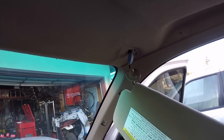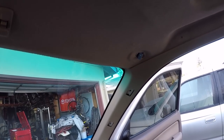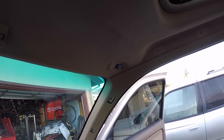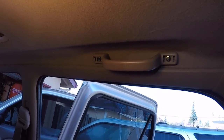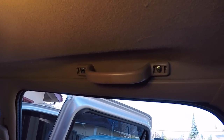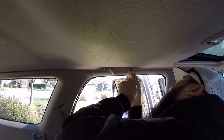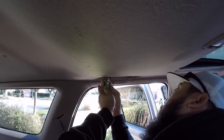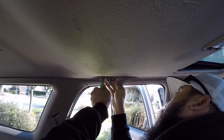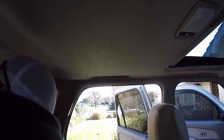There's a plug you have to disconnect. Just squeeze the connector and get that out — super simple. Now we're on the passenger side in the rear. Same thing on driver and passenger side — you have a grab rail on the headliner, just remove the Phillips head screws. One thing to note: you're removing quite a number of different screws and they are a little bit different. Keep track of what screws came off which piece so you get them back in the right spot.